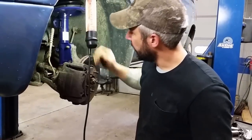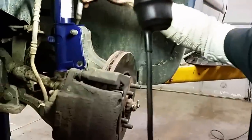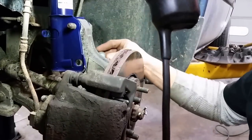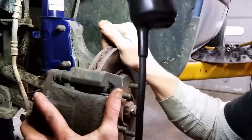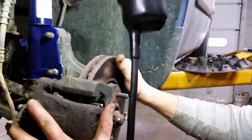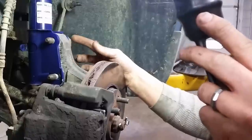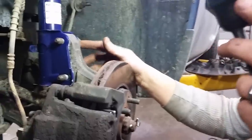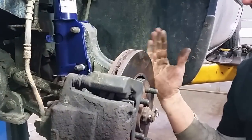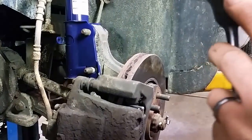Now before we get too far, I just want to point out one thing. Look at this lower bolt hole in this strut — you'll see that in this aftermarket strut, this hole is elongated. The factory struts are not. So when you stick this bolt in, there's going to be a latitude of movement there, and you're going to be able to tighten it down in just about any position. What that means is when you're done with this car, take it to your local shop and have the camber and toe reset on the front, because this will change the camber angle. Camber is the vertical alignment of your tire and wheel assembly. With that strut being slotted, make sure you get the alignment done as soon as you get this done — otherwise it'll destroy your tires.